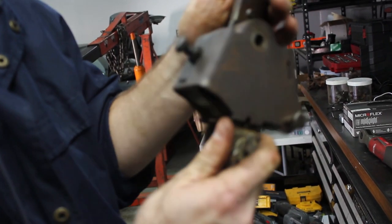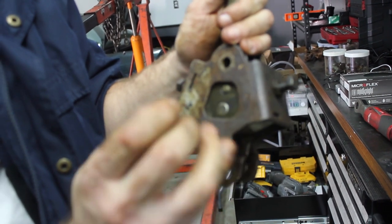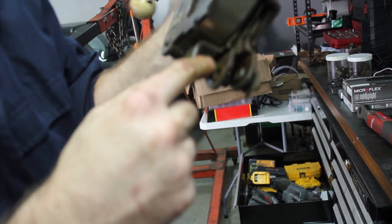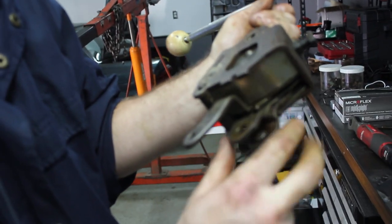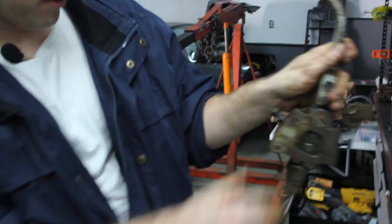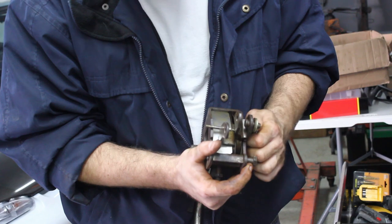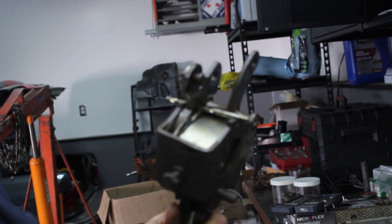There's a notch there, and a notch there. A quarter-inch drill fits in the notch, and you can see a notch on each of the shift levers — one there, one there, and one there. So when you're in neutral, what you do is you put this drill through this notch, something like that. That's what you want — that's how you know you're in neutral.